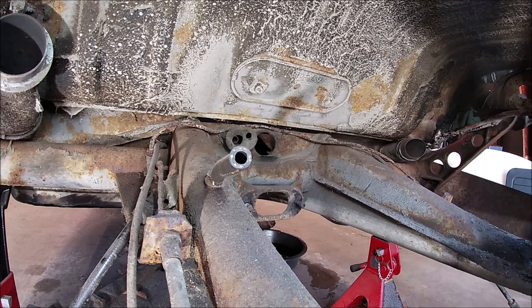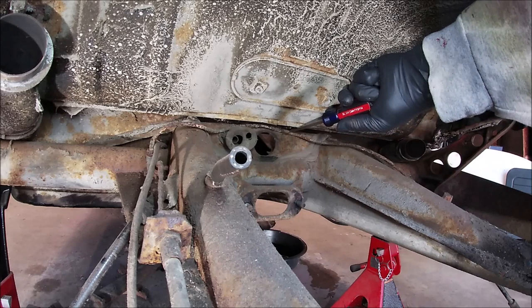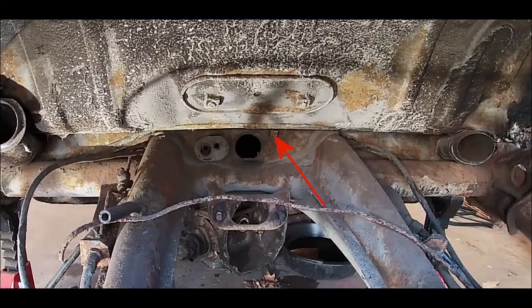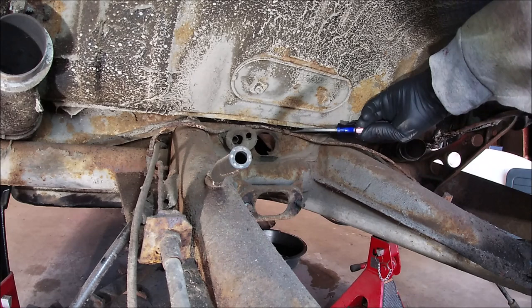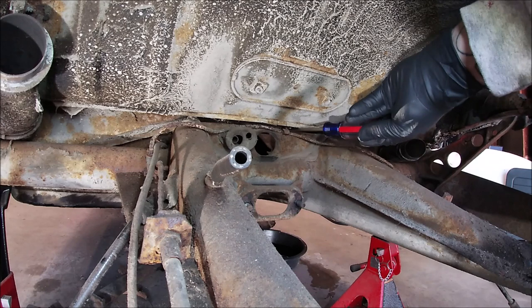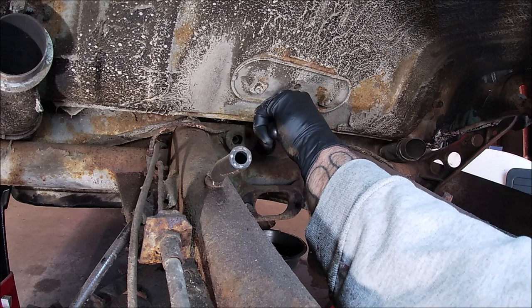There's a little tab up in here — I got to get a screwdriver up there and get to those tabs. When you're prying on these little tabs, don't act crazy because you don't want to break them off. You're just bending it enough to get the brake line out — see how I'm moving slow? Just slow. That's all the further you need to bend it, because if you break them off you'll be trying to spot weld them back on.